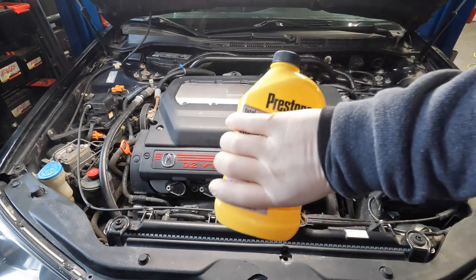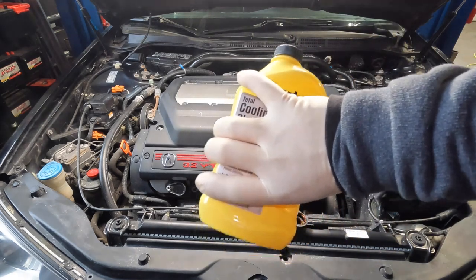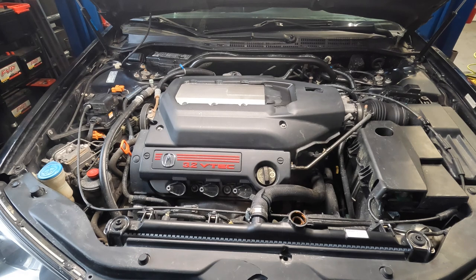I'm going to block off the product name, but here's how it works: it requires you to drain the cooling system, fill it up with water, then add the system cleaner. For a minimum basic cleaning you run the engine with the water and solution mixture for 10 minutes, but for maximum cleaning you need to run your engine three to six hours. So this is not something that gets done in one day — it's going to take multiple days because I'm planning on flushing this system twice.